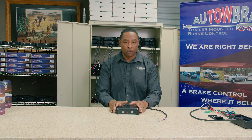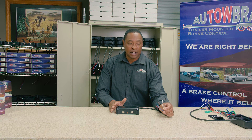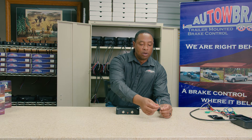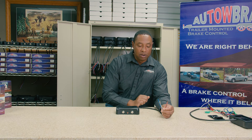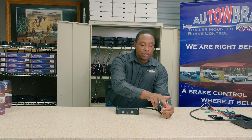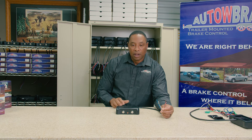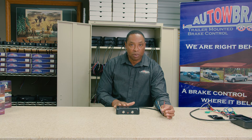You also want to try to isolate the Auto Brake in that scenario. There are times where you take the Auto Brake black wire, keep it on the hot line, and connect your brown and red with your black to fool the system. You have everything wired up — your white and your trailer blue wired up — then connect your black, brown and red. The reason you're doing this is to determine if the Auto Brake has an issue or if it's something else. If you do this, it should light everything up for you, just like in our bench testing — the same scenario.